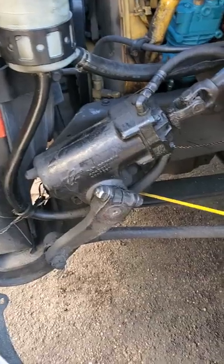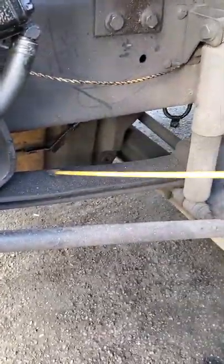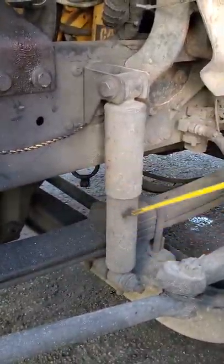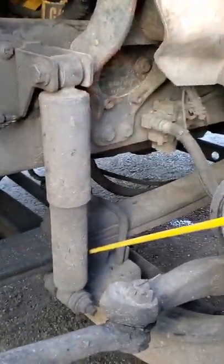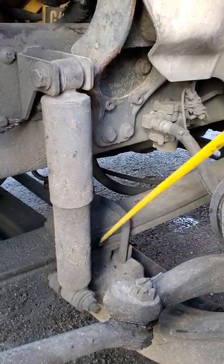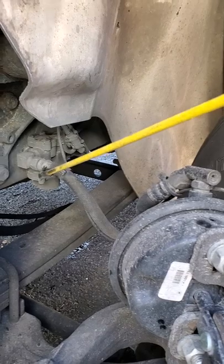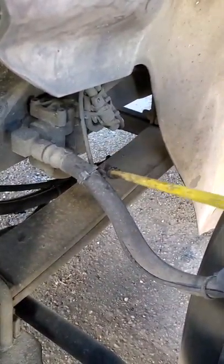Not cracked, broke, or twisted, and the bolts are tight. It's not cracked, broke, or leaking. The U-bolts are securely mounted. They're not cracked. There's no shiny metal indicating looseness. The brake line is securely mounted. It's not cracked, broke, or leaking. The ABS line is securely mounted — not cracked, cut, or frayed.